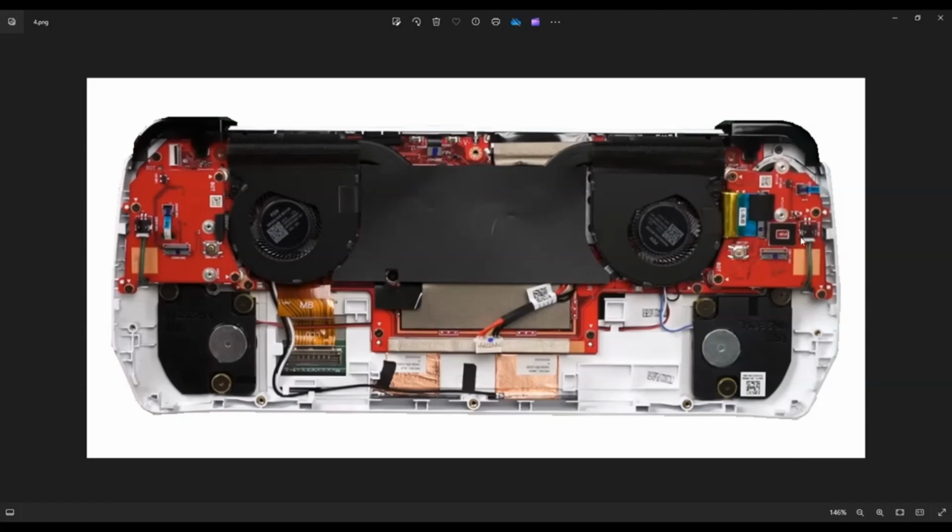There's also two cables right here, and one here. Same thing as the battery, grab that white plug, don't grab the wires, pull that out. And then you have two ribbon cables, smaller than the ones on the battery, end up here. Same general idea, you pop that gray tab up, or that gray clip up, and the ribbon cable will come out. This one's a little larger, this ribbon cable, there's a piece of black tape over it, so you gotta get that black tape up, and then you can pull this out. But after unscrewing that, these boards will come off of the main board.